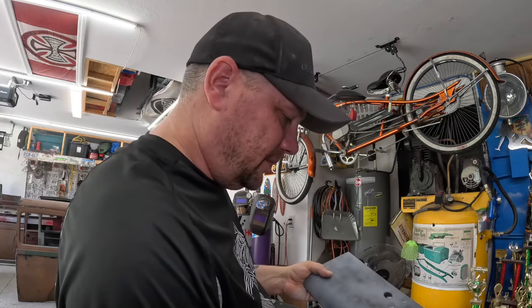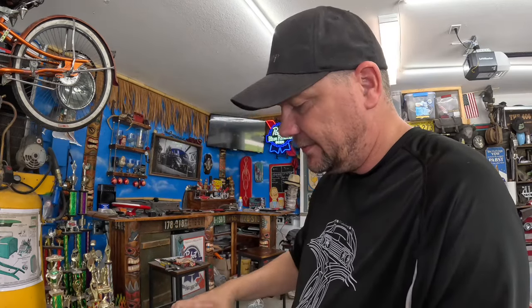So this is 600 grit. Wet paper, wet or dry. So before we paint this stuff, we're gonna wet sand it with that 600 grit. Doing it wet prevents our paper from getting gummed up with the primer and leaves a nice smooth finish, but not so smooth paint won't stick to it. Kind of our last effort into making sure that this is straight and not wavy or pitted or anything like that. So we're gonna be box sanding it just like we did the body work.